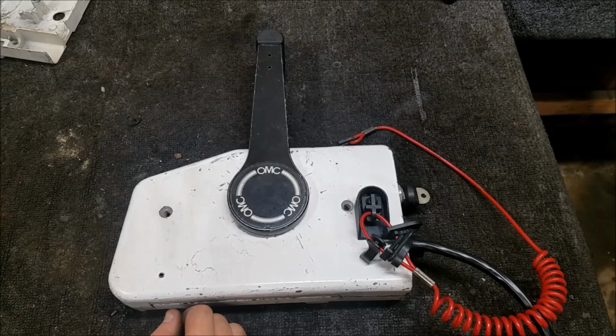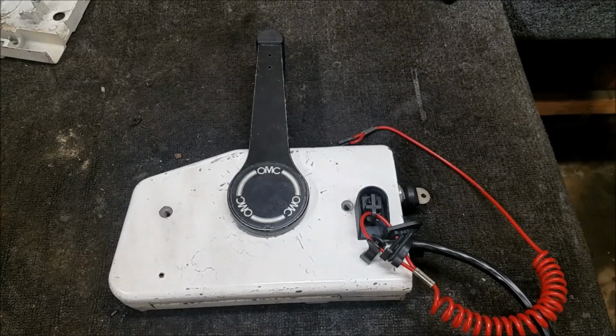So, these next little things are called crimp splices. See what it is? That little guy is like 70 cents each, but man, does it make a nice splice. You'll see what it looks like when I'm done. What the crimpers do is they fold it around inside itself, making a nice good crimp. I love them. I think they're the best crimp you can make. Now, granted, it's no butt splice. I think it's a lot better. Only problem is, it's hard to do.